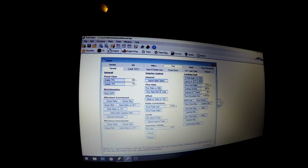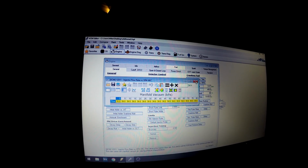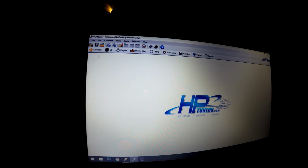The injectors are still the same, so this remained the same, 94.6 for our 80 pounds. All this stuff just works for us. It's not exactly copy and paste for your combo. So that's why I don't go into too much detail about what I do, but as far as things you can do, it's good to point out that electronic throttle control thing is something I learned today, so there's a tip for you guys.